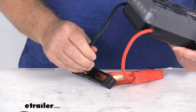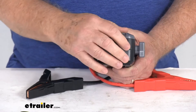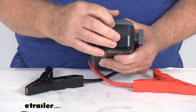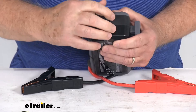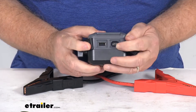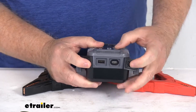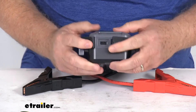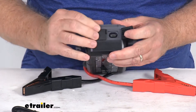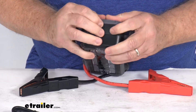On the other end there are two USB ports covered with rubber covers. With these covers over the ports it gives this jump starter an IP65 rating, keeping them protected when not in use. The first port is a standard USB output at 2.1 amps. The second is a USB-C input and output at 60 watts, providing a super-fast port that'll recharge this unit in under an hour — going from dead to jump-start ready in about five minutes. It comes with a USB-C to USB cable for charging.